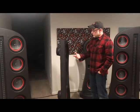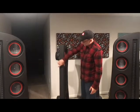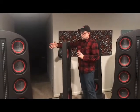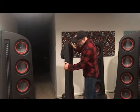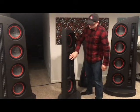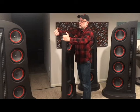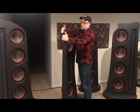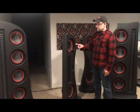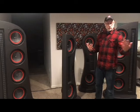I'm a really big fan of open baffle dipole speakers. When you don't have a cabinet, the back of the drivers fire into air, and the back of the tweeters and mid-range panels fire into air as well. As a result, sound comes out in both directions, wraps around, and where the sound meets on the sides above and below the speaker, it cancels out. A lot of people describe the effect as sort of like wearing headphones, but with speakers in front of you.